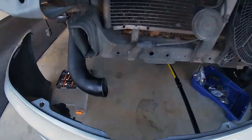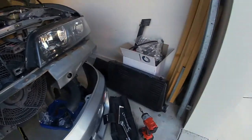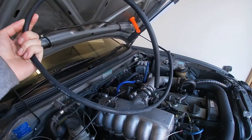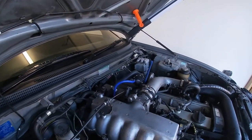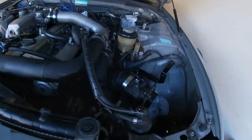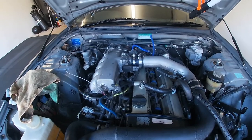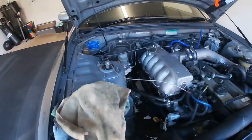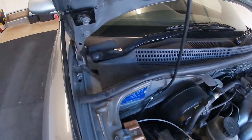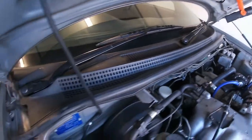The other thing is I'm just waiting for some aero flow couplers to go from the intercooler piping into our newly painted intercooler. Next up we're going to replace most of the vacuum hose with some Gates black silicone hose — so we're going to replace those blue ones back there and also the one for the Boost T, which was a red colour. We might trim them a little so they fit a bit better. We've also cleaned up the intake with some degreaser — it's come out pretty good.